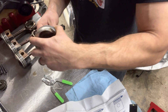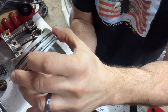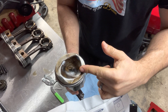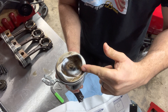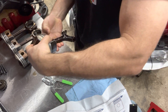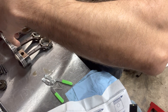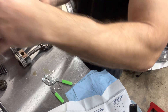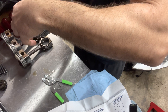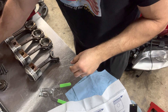Now you can see there are little gaps on the pistons. See how these two are lined up right now - that's terrible, you don't want that. You want these gaps to face away from each other. The Audi manual says you want them at 120 degrees offset. So the bottom one would be at one position, the middle one 120 degrees away, and the top one another 120 degrees from there. What I do is take the bottom one and rotate it so it faces the skirt, take the middle one and go 90 degrees plus another 30 - putting it on the edge of the other skirt - then use my fingers to get the top one to another 120 degrees away.